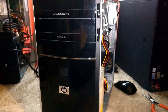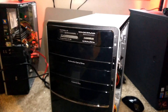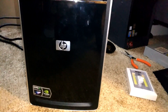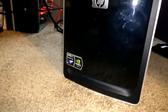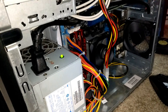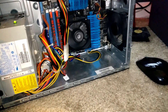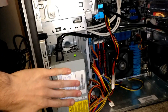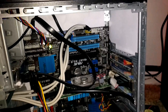Alright, so it's done. I got this old HP from about 2006 fitted with a new motherboard and an AMD FX 8120 8-core. It did have a Phenom X4 with Nvidia graphics, but that board went bad. So I had to fit a full ATX board into this micro ATX case, which worked surprisingly — I didn't think it would work. I did have to move the power supply to the front of the case. Here we have the ATX board — you need some light to see it.